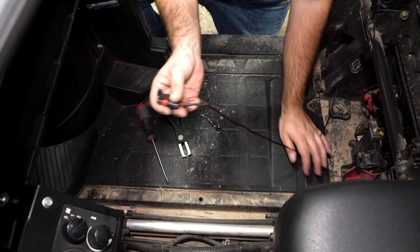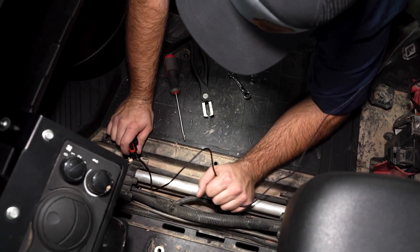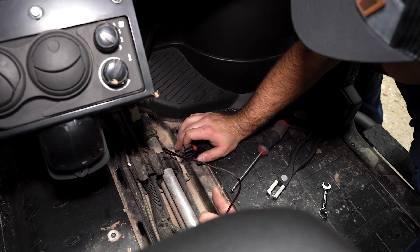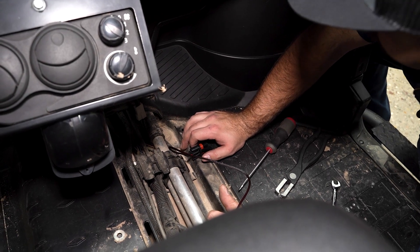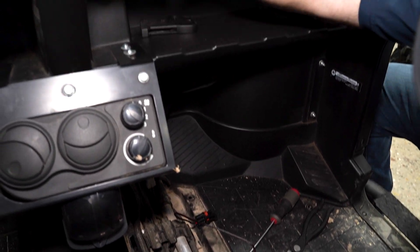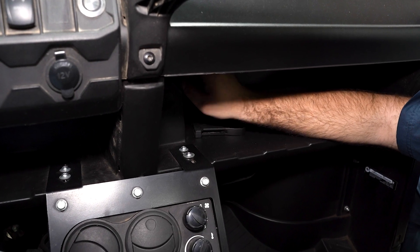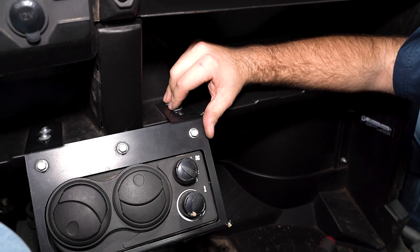Here's our keyed-on source harness — we just ran that down the same way that we ran our hot and ground. Here's where it gets kind of tricky with us having a cab heater. Typically you wouldn't have all these heater hoses in here and you can just fish a wire down and grab a hold of it. In our situation it's going to be more difficult, so what I'm going to try to do is go all the way up here behind the lower dash, feed a wire down, grab a hold of it, and try to pull my connection up. If I can't, then we'll probably end up having to remove the lower dash, which opens it up wide to where you can just slide right in there and route your wires up.